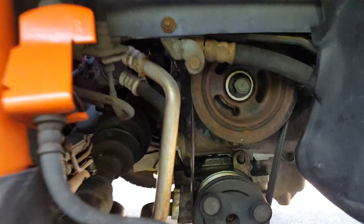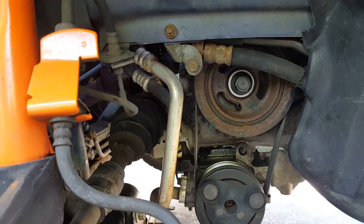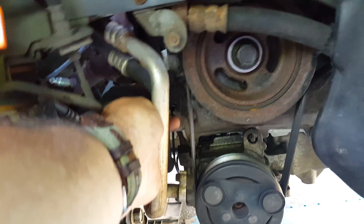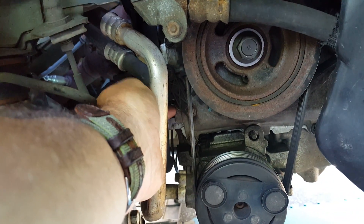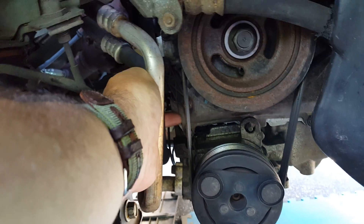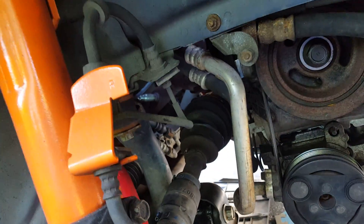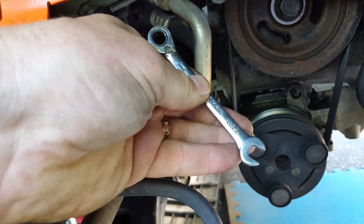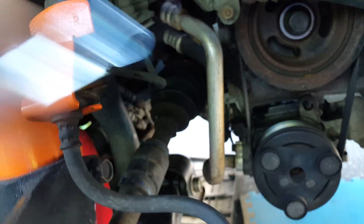This is the area where you're going to see it. It's a little bit hard to see in there, but your timing pickup is right here. There are two 8mm bolts. You can use what I used to get to them easily — a ratchet wrench, an 8mm ratchet wrench.